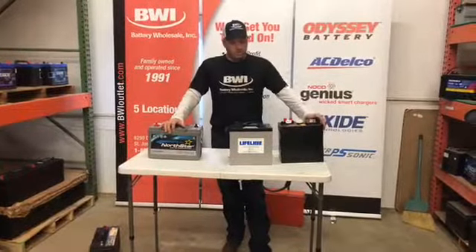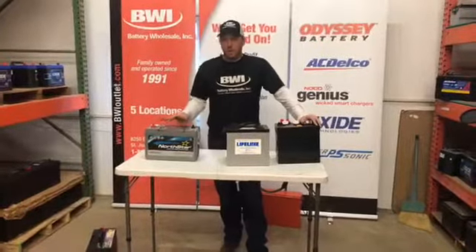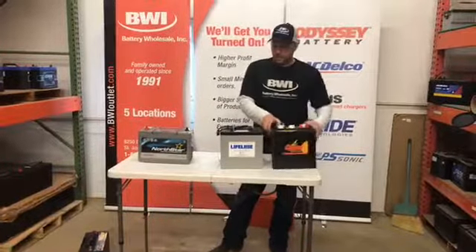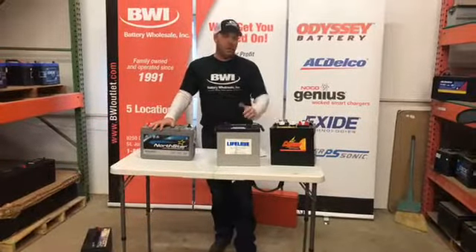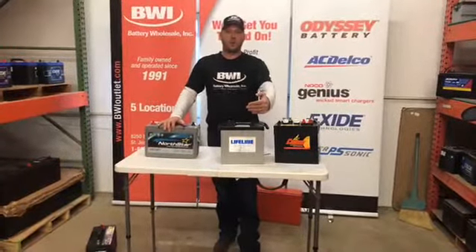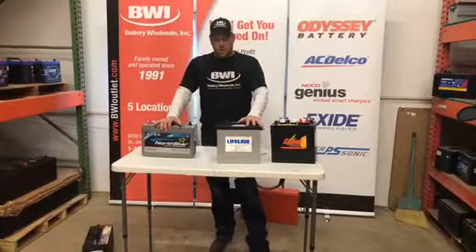I am just doing a short video here — first time we're ever doing a Facebook live — just trying to give some simple basic knowledge on how to start sizing up the house. Some guys will migrate from a group 31 AGM and go into some six volts. A lot of campers are using these now. Some are coming with a wet cell inside, like the Crown I have here, or they'll move up to a Lifeline six volt, which is also an AGM. By doing that you're going to up your amp hours. Amp hours basically are like a fuel tank for how long you can run between charges. We'll also start talking about charging systems and making sure you have the proper charger for the different types of batteries.